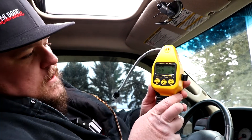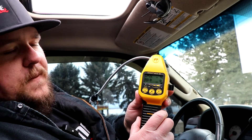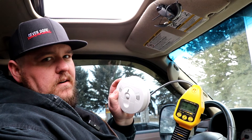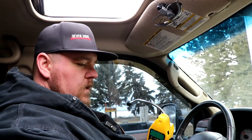So that you guys know: a dangerous level — anything above 50 parts per million — is dangerous. Anything over 100 is super dangerous, lethal, bad news. Alright, here we are inside of the truck, we are ready to commence our testing. We have the cool guy tool. If you look there, you can see it has a few different readings on it. It's got what the oxygen is, and this is the one we're going to be interested in — the parts per million of carbon monoxide, CO. And for a fair comparison, we have the standard house carbon monoxide slash smoke detector. So we'll see if this dude even goes off at all. I already have a suspicion, but we'll see. Cold start — here we go.